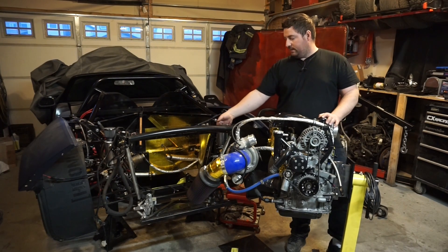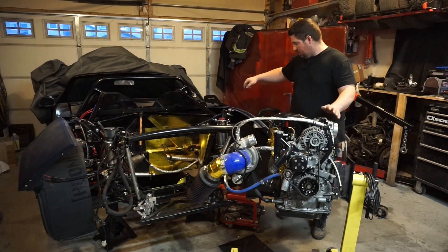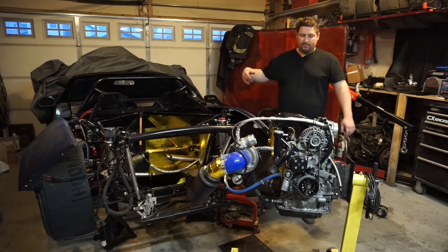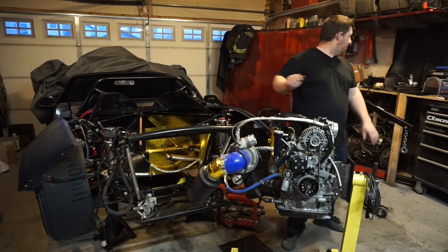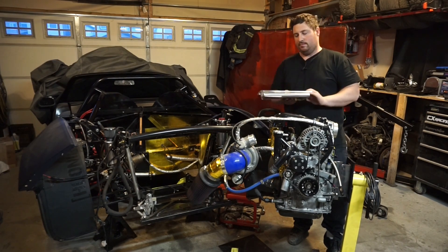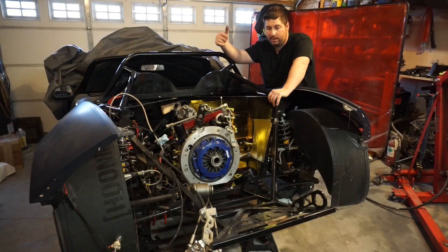The frame mods are all done for the six-speed — I didn't test-fit with the five-speed so I think the five-speed will still fit. I've got my panel mounted and bolted on my heat shield so I knew roughly where the top of the turbo was. I put this heat insulation sticky tape there — it's the CoolIt ThermoTech rated at 2,000 degrees. It shouldn't see that heat because the turbo is ceramic coated. The engine is in.